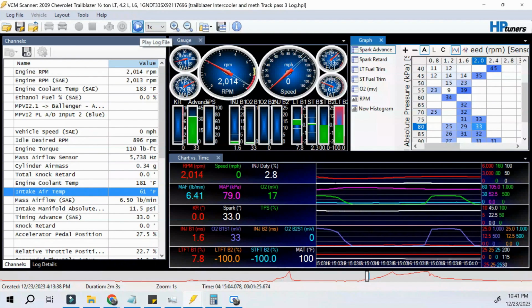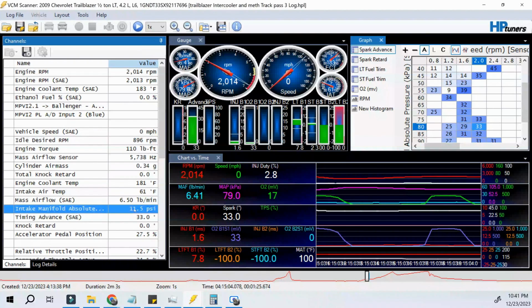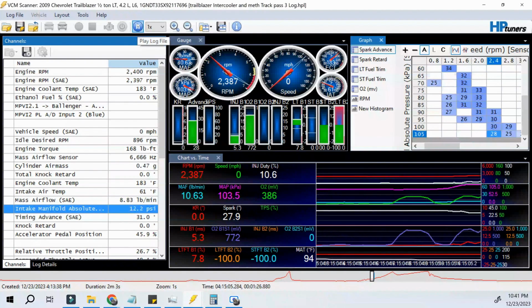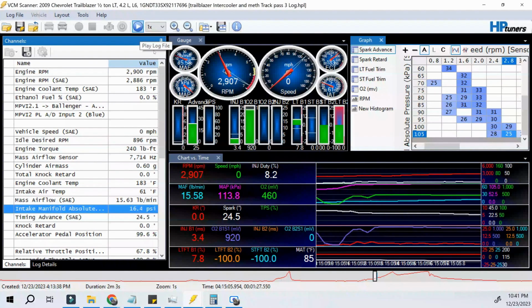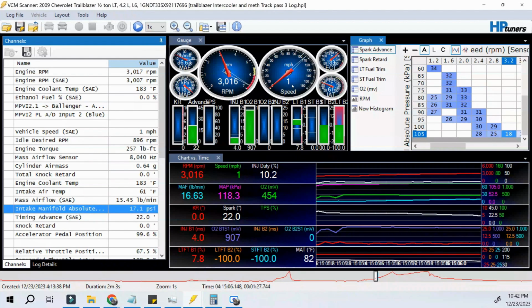You can see this because if you look at intake manifold absolute pressure, you will see this value increase because I'm loading it up: 26, 28, 2900 RPM. Right now, we are at 2 pounds of boost, not moving. And there it is, 1 mile an hour, roughly right at 3000 RPM, somewhere between 2950 and 3000 RPM. I'm launching it. Let's see, 17.1 minus 14.7, that's 2.5 pounds of boost we left at, which is probably why it cut a 1.9 60-foot and 4-high.